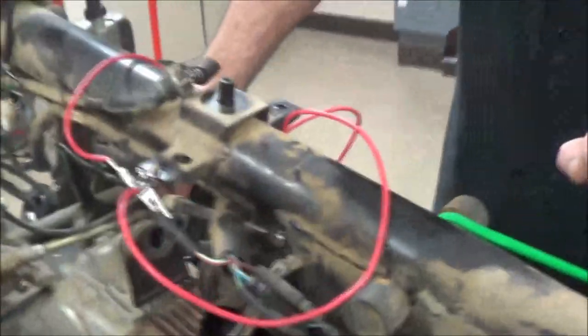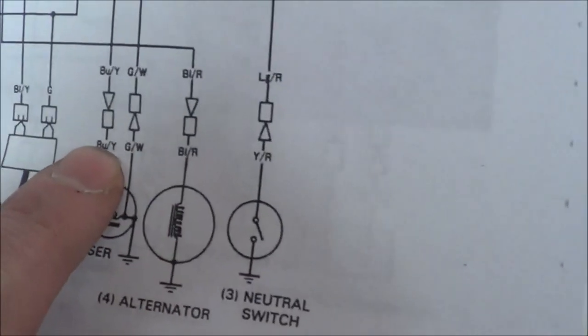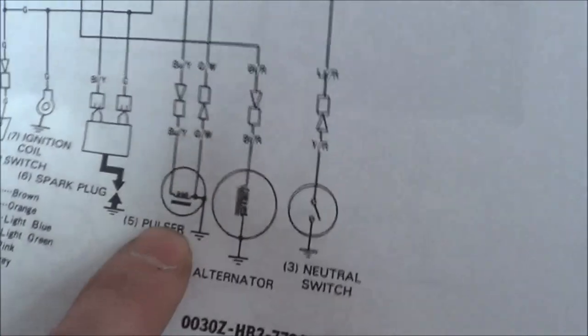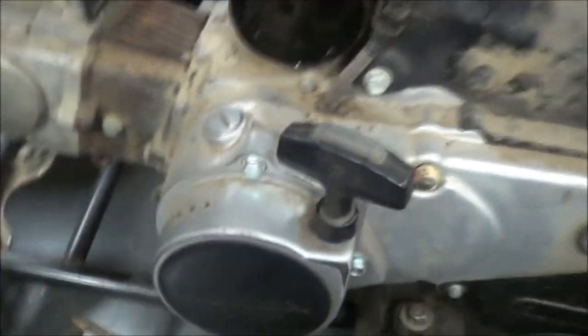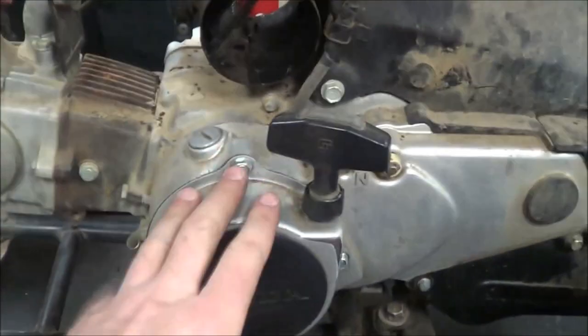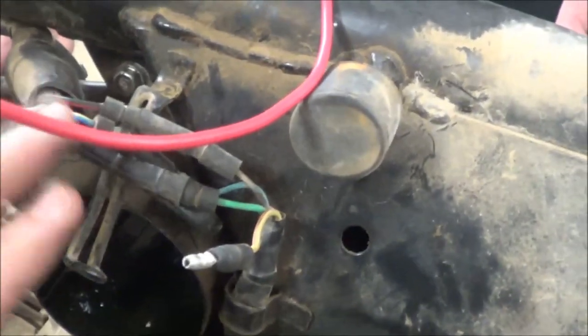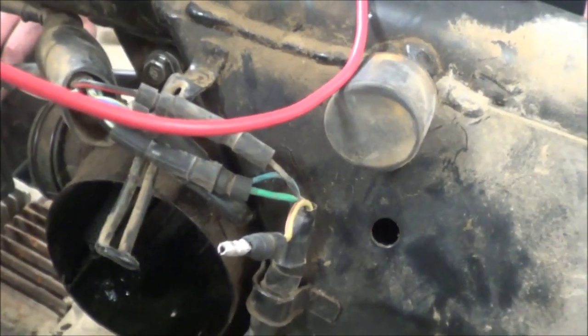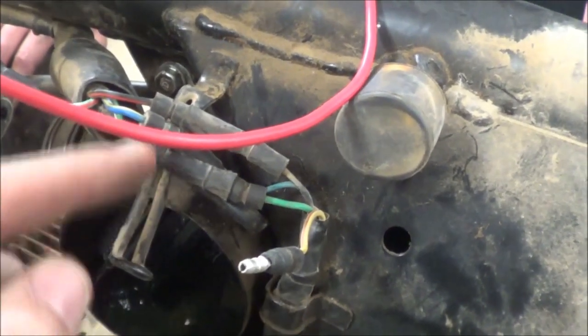Chris, talk about the test we did on the stator itself — the part we were told was bad. We were testing the pulse coil. We had a blue-and-yellow wire and a green-and-white wire coming out of the pulse coil, and we had to test for continuity between one of those wires and ground. All those coils are underneath here and come to this harness. The manual gave us a continuity spec of 80 to 120 ohms, and we performed that test — it was good.